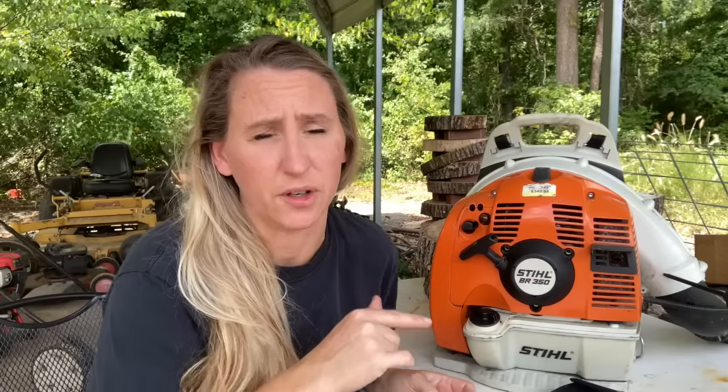And so I thought, well, maybe the exhaust is clogged, because these are the worst units to have a clogged spark arrestor screen in the muffler. So I do have a video on how to fix that. I'm gonna put a link above in case you need to figure out where it is and how to fix that. But I went to check the spark arrestor and it wasn't even in there. Whoever had worked on it previously just took it out and didn't put it back. So obviously at one point that was an issue.